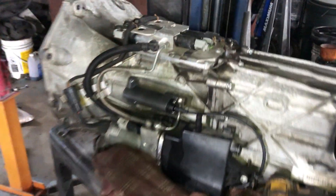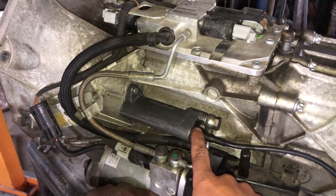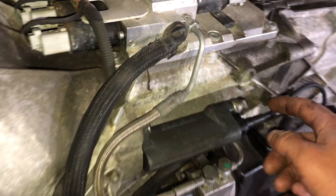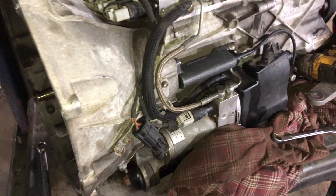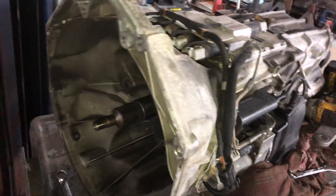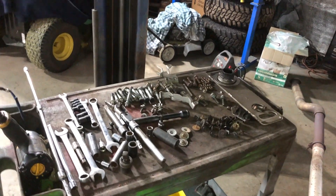A few of the parts showed up already. The new slave cylinder is installed — the position sensor was brand new just a short while ago, so this whole setup is brand new. I've got it bolted in place and torqued, hydraulic lines connected. Our next step is to fill the reservoir up, and when the rest of the clutch pieces arrive — the fork and pivot bushing — we'll be ready to put it all back together and attempt to bleed the system. The whole system essentially blew apart and lost most of its fluid, but at least this time everything will be essentially new.